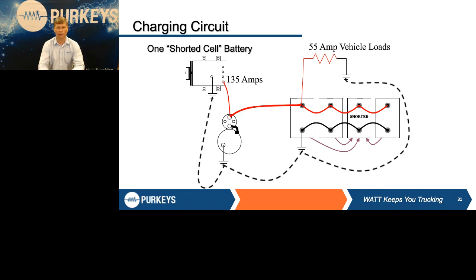That alternator's been doing everything it can trying to charge those batteries. So a byproduct of that is lots of heat. And because those batteries are not coming up, you're still going to see a very low voltage and it's easy to condemn the alternator. What's wrong with the alternator? Absolutely nothing. It's doing exactly what it's supposed to. It doesn't know you've got a defective battery there.